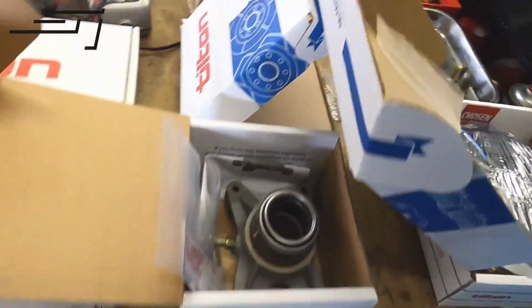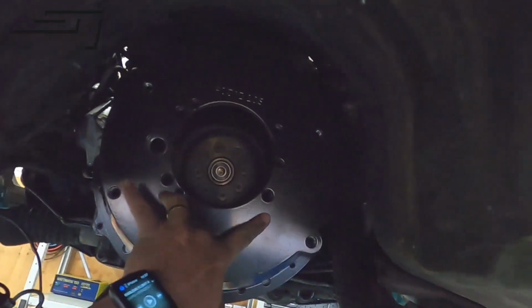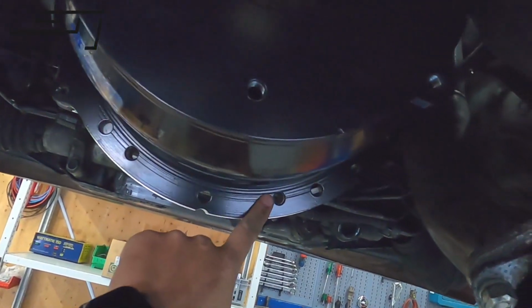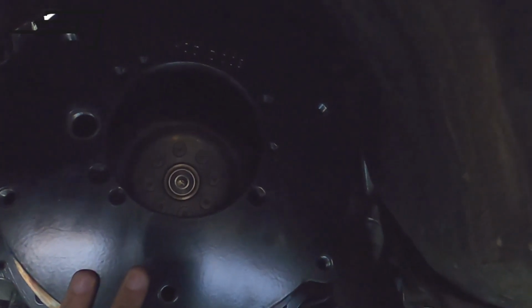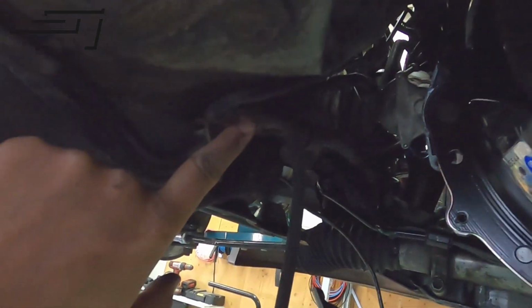So let's do this. We have all the goodies ready, but besides taking all the measurements, we are missing some of these bolts for the hydraulic release bearing. So we need 4 of those. We're also missing these, as said, to connect this to the engine, because I don't want to use used ones. And we're also missing the lines connecting the hydraulic release bearing to the clutch system. So basically this over here, because all this still has to go.